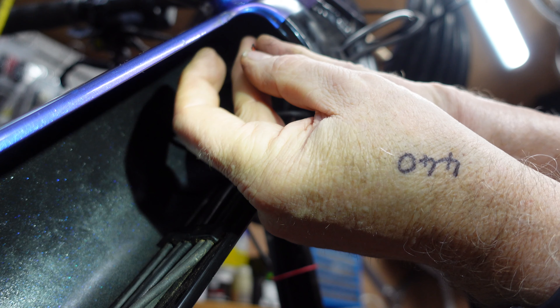I've put the light on the handlebar mount to keep it in place while we feed the cables back through the hole. These connections are watertight and will stay dry over the top of the battery locking mechanism. The cable has been fed through, and we didn't need to take the locking mechanism out — we could manipulate the cables quite easily once the plastic cover was removed from the locking plate.